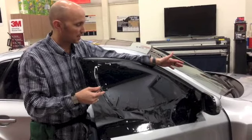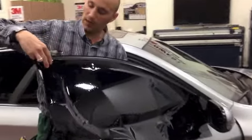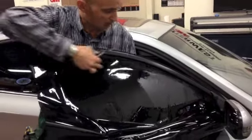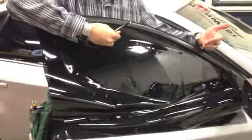A lot of new tinners have a hard time trying to make a clean cut, especially when you're doubled up. So what we generally do is teach people how to go ahead, keep the film on, start with your top border cut first. That way, if you do get a jagged edge or anything else, you have room to move the film up and make a secondary cut.